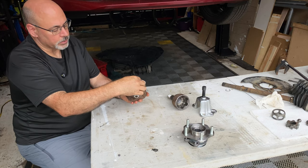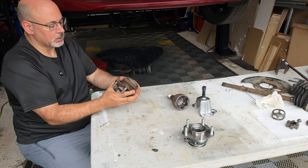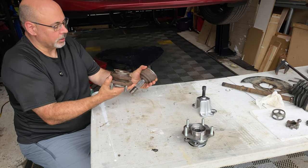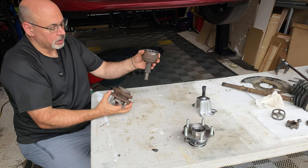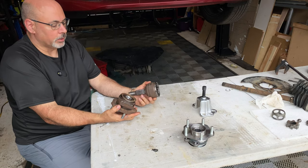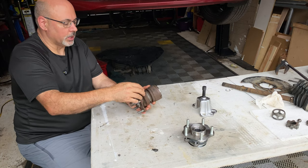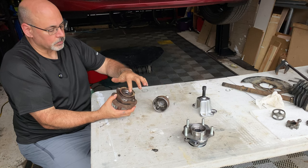This thing is machined — there's a process to roll-form, basically rolling a bead over — and what it does is contain the wheel bearing preloaded inside. So with this type of bearing, when you are tightening the nut and pulling these pieces together, you're really just compressing the hub and the roll form together. You're not doing a whole lot of additional preloading; you're basically just stabilizing these two pieces together with no deformation of that roll form.